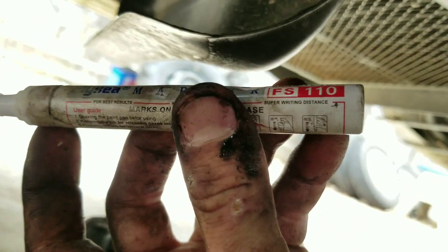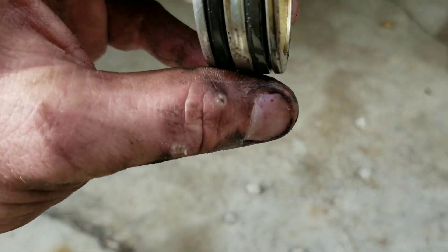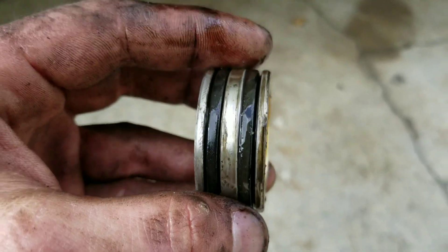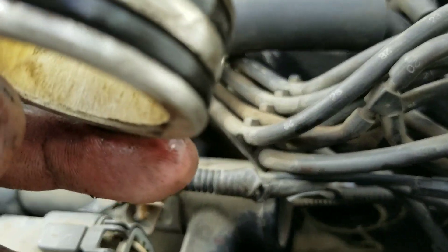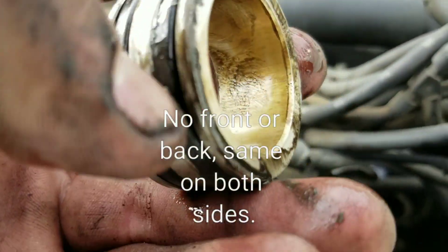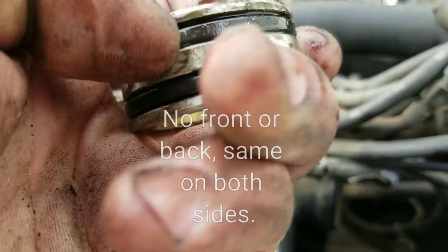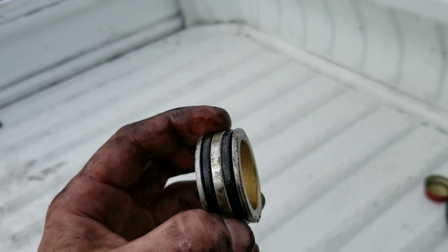I just got one of these paint pens — it's oil-based, about a dollar, order from China. Many truckers, this is the leaky part. It sits into that hole like this and is just set in there. There's a front and a back, and these o-rings just get so brittle they turn into plastic from rubber. I have three of these parts. If you need one, go ahead and get on that US Mini Trucks website and order one — stop that oil leak.